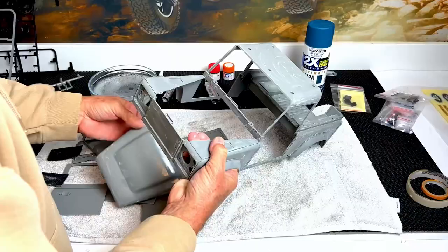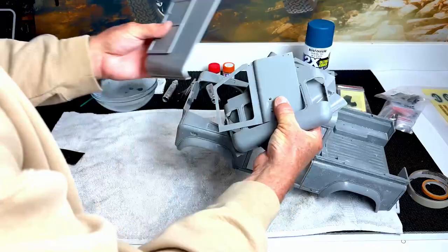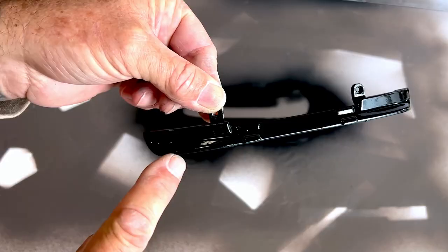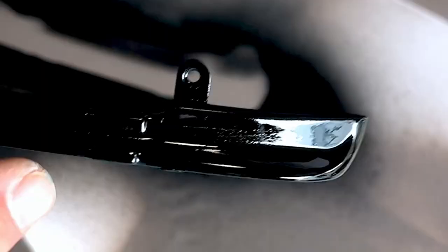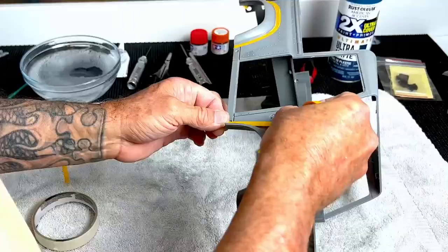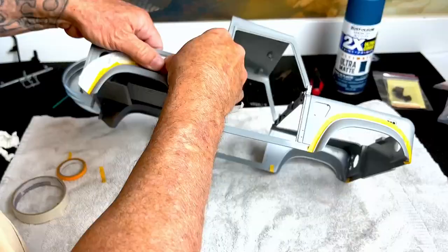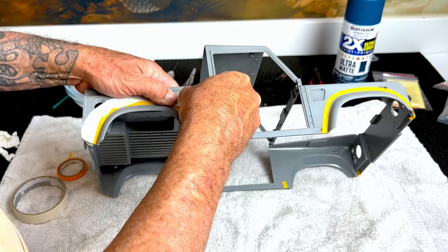The doors and the hood seemed to fit pretty well, so I gathered up the parts and headed off to the sink to wash them thoroughly with some soapy water. We're going to set these parts out to dry, and while we're waiting we're going to do a little science project. Since we're doing a two-tone paint job, I wanted to show you what could happen when applying one kind of paint over another — these really bad wrinkles can occur. I've even seen this happen when using two colors of the same paint; it has something to do with the base color and dry time. I'm using two different brands of paint and I'm not taking any chances, so I'm going to mask off the fenders and paint them first, mask them off later, and then paint the main body.